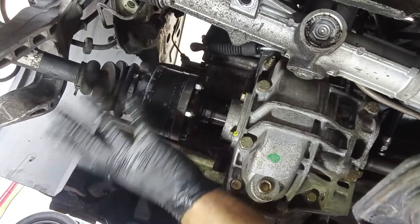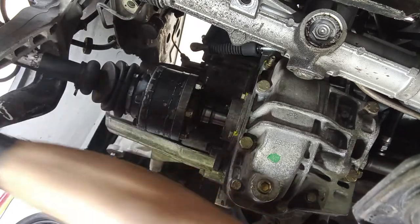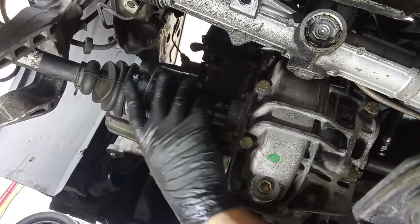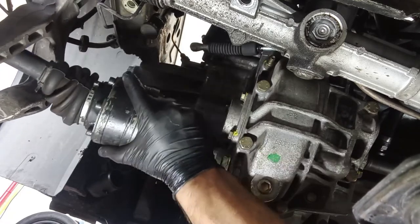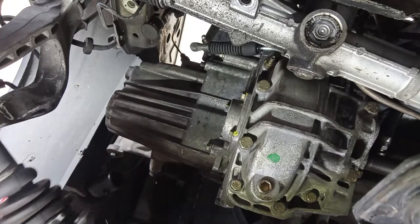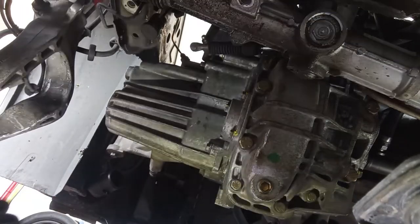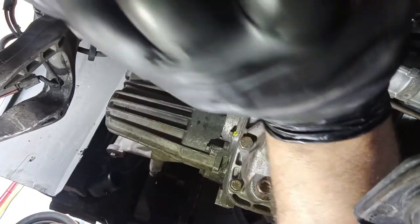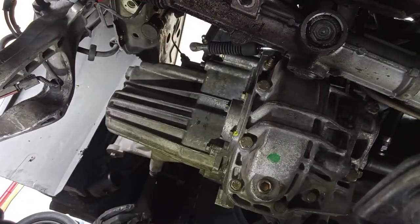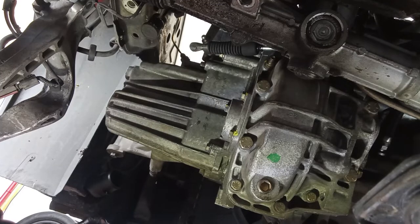So this half axle stays attached here to this entire structure of the suspension and just goes to here, and I lock it with a zip tie, for example. Okay, and the other half axle stays there. Yay, why not? I like to do it like this. It also gives me one more vantage point to engage it when putting the gearbox in.